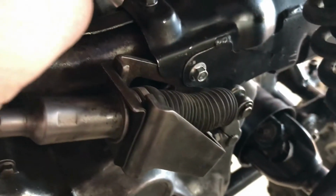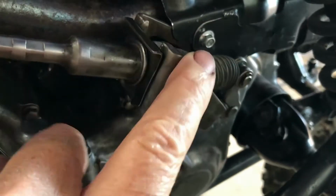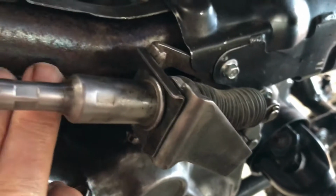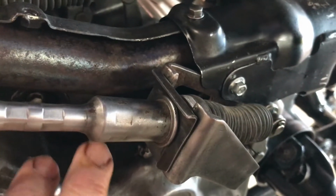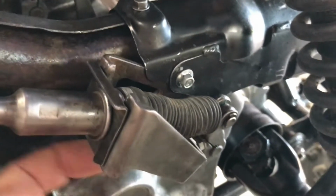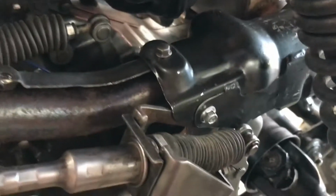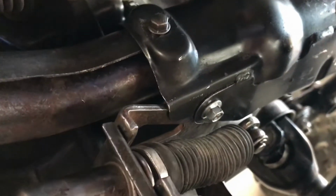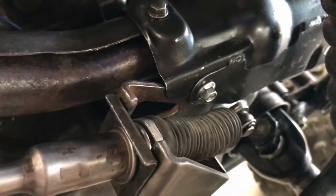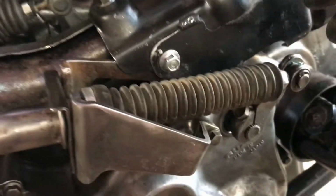So there's the rear cover on, and it's bolted to this bracket. I think that bolt there would normally go into the cover that goes over this part of the pipe, and there'd be a captive nut in the bit of tin that would be there. I've put a nut in behind there just to bolt that cover to this bracket, and now there's plenty of clearance down the side there for the high and low range selector, going through its motion nicely.